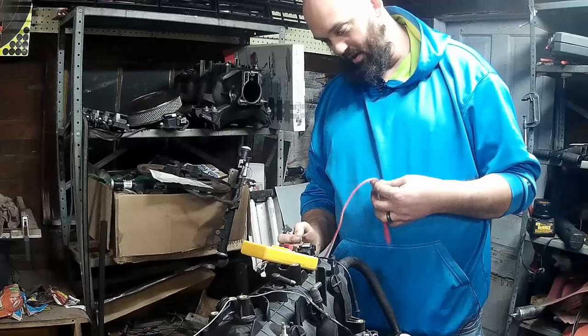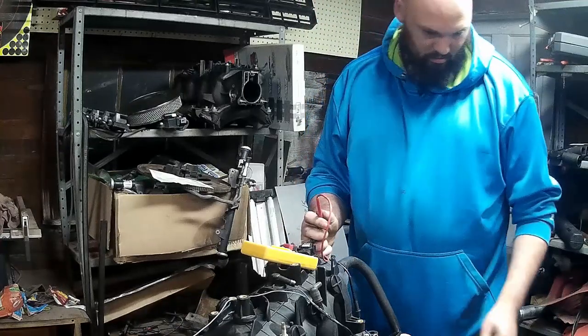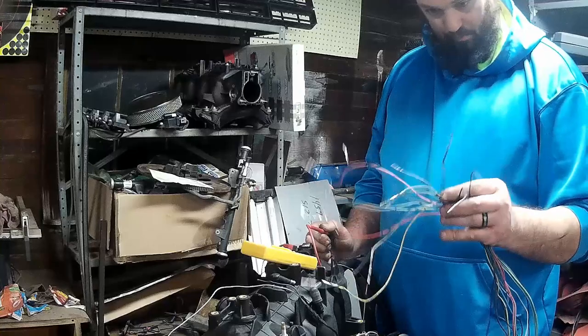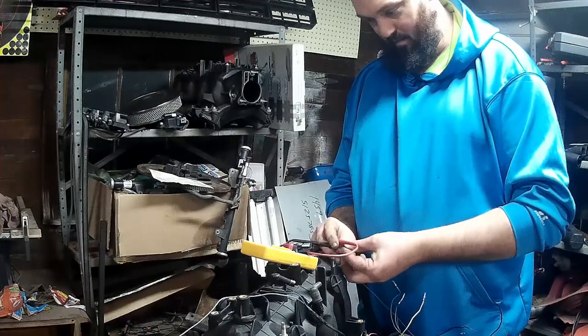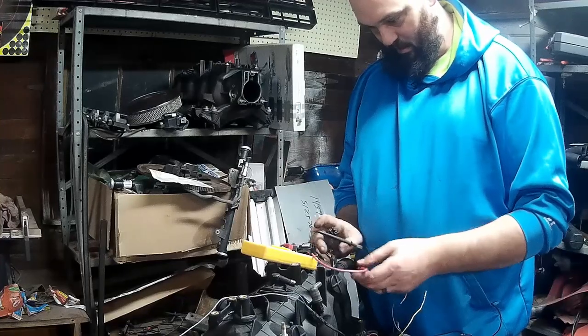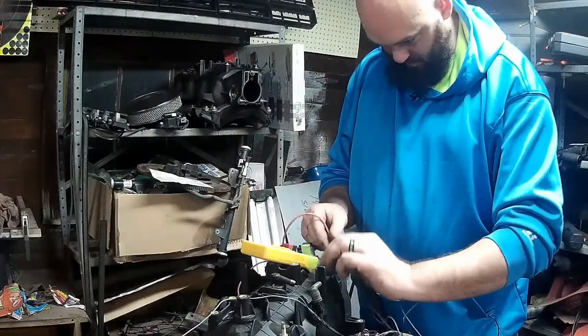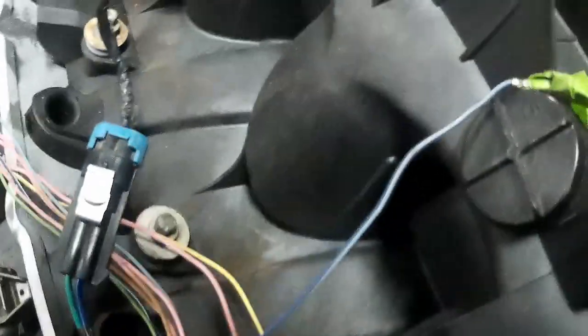So to check to see if my wire here is broken, I'm gonna jam this into the red side. I'm gonna go down here to my ECU side, and I'm going to stick this on there. Now, let me show you if I can. I'm gonna have to cheat at this a second. Alright, now let me see if I can cheat. I taped that. We got a blue wire with a white tracer. We got a 1 here. So on the other end, there's my blue wire with a white tracer. I know it looks black on film, but it's not.